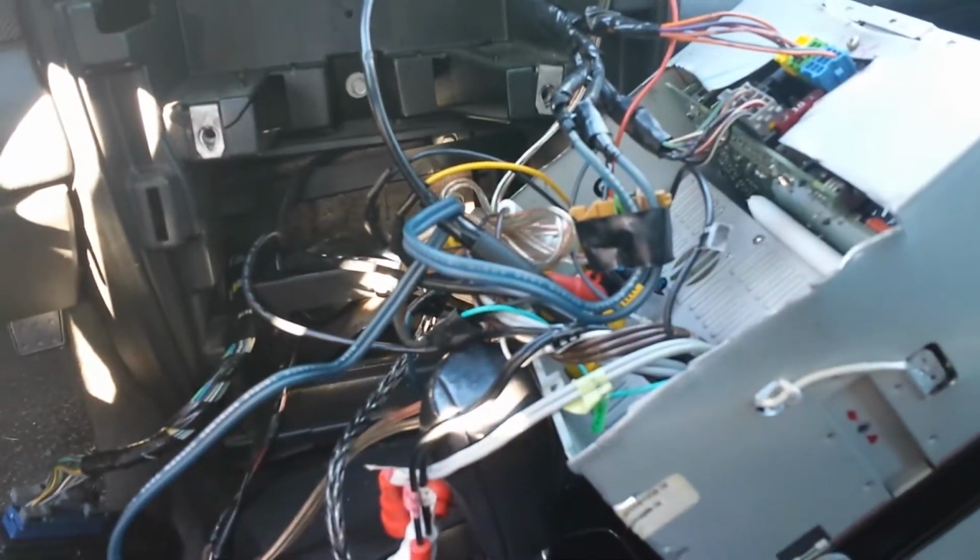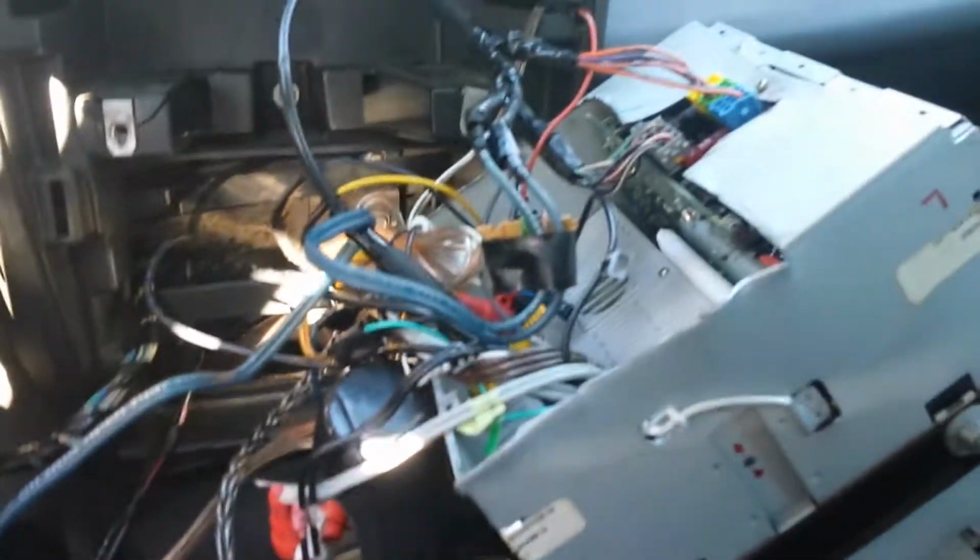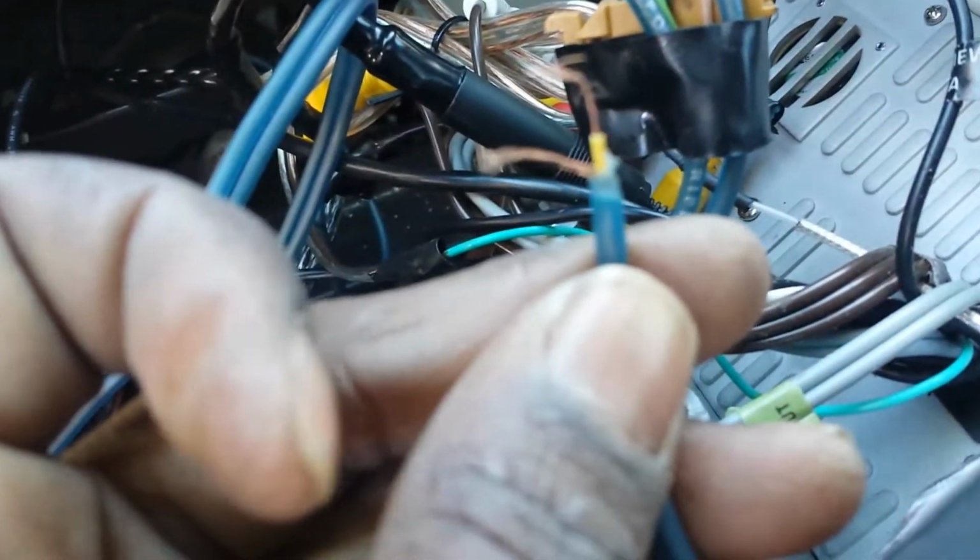I know y'all seen the video of it all working, but I'm gonna try to set this back in right quick, and I'm gonna still show it to you. So I hope y'all seen that. The middle plug is 10. Cut your 4 wires. You don't even have to plug this back in. Cut those 4 wires. Use your jacks. Get them right. One side, both of the light greens. The other side, dark green and brown.